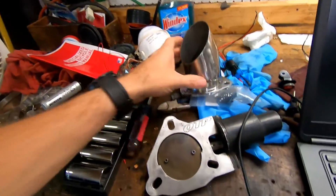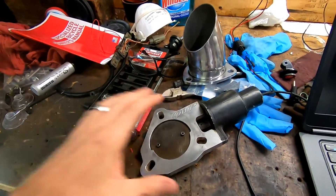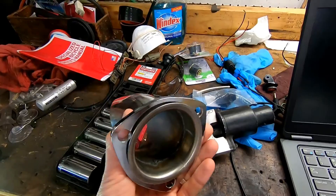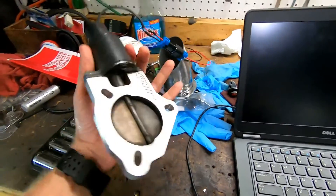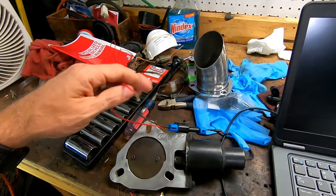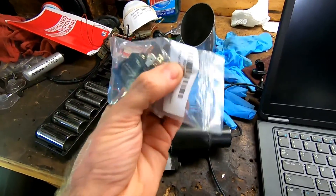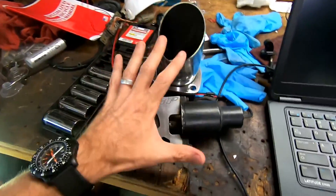So this is an electric cutout, and it is going to dump right here. This is a QTP part and I ordered this from Amazon to fit a QTP electric dump that was given to me for free. I've got a buddy who had one, didn't want it anymore, and gave it to me. I've hooked it up — it works. It's just a polarity thing: positive, negative, and reverse polarity sends the motor the opposite direction. I went in and ordered a switch for this, and I'll get into the details of installing it in the next video.